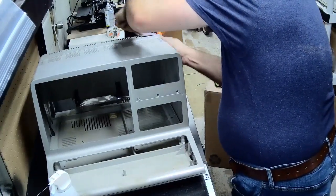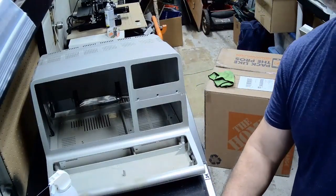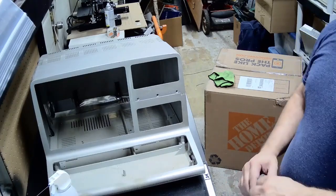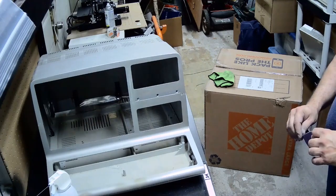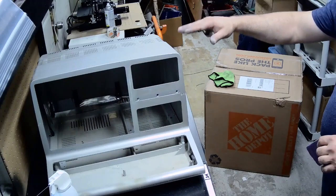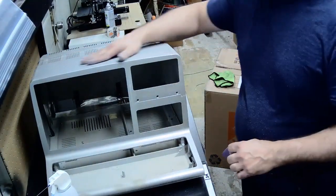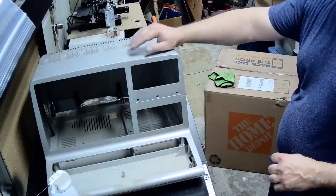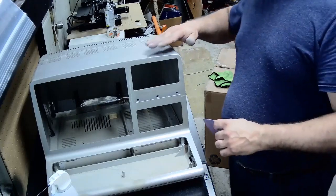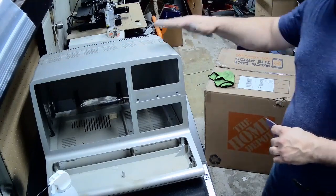Unlike a lot of places, you don't need to literally remove the paint off the plastic. All you need to do is make the surface clear of its first top shine, because you're going to repaint into it. The material you're scratching right now with the sandpaper, you're going to do like I'm doing here, a rough, then you're going to pass a 500 wet, then you're going to prime it.